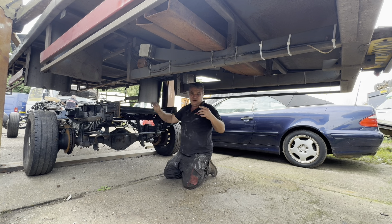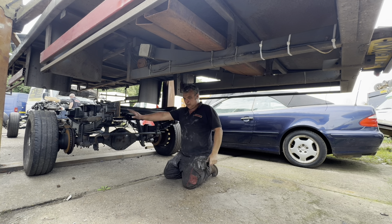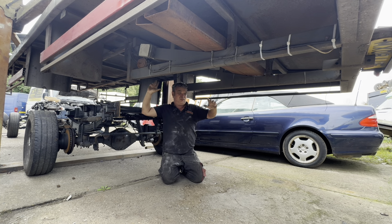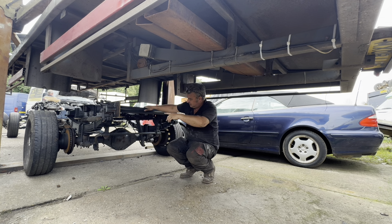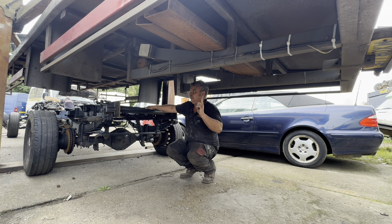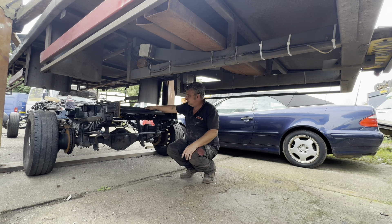So we're going to have a bit of a redesign. Above my head you'll see two massive new chassis sections, all folded up. We're going to cut all this junk out, take off the A-frame entirely, and properly beaver tail the chassis to match the profile of the beaver tail on the end of the body. Then we'll remake proper mounting points that give it the ability to flex, reinstate the ramp stays, and sort a proper tow bar device properly joined to everything. It won't take long.